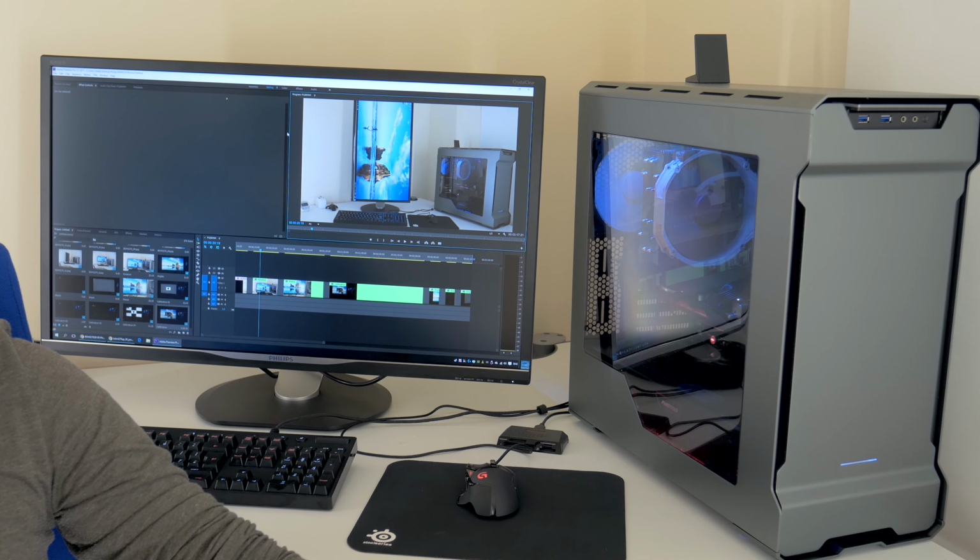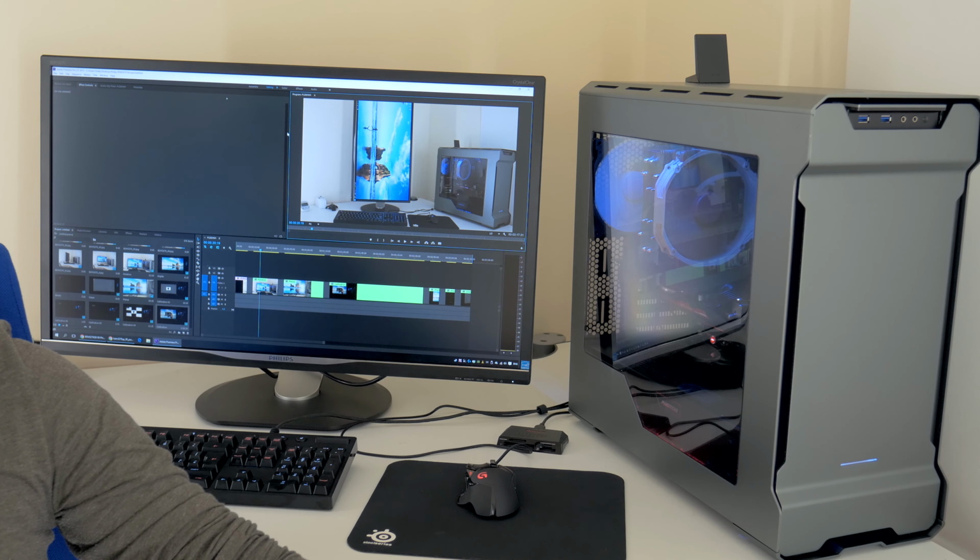They're obviously a whole lot better than the TN panels that most affordable gaming monitors would use. Next, obviously, was my test of the blacks, because I know that IPS are horrible at blacks, TN is great at blacks but horrible at color reproduction, and AMVA should be great at both. And sure enough, I turned off the lights, put a black background on Windows, set the brightness to 50%, which is what I would use normally, and rotated the display all around, and it's fine.